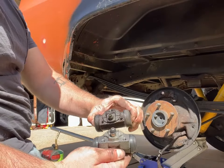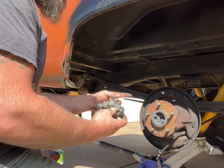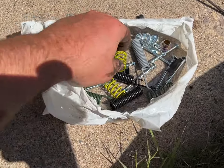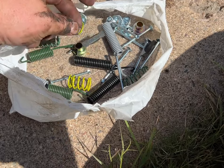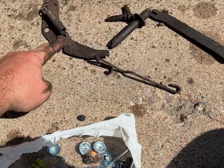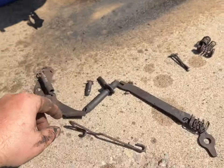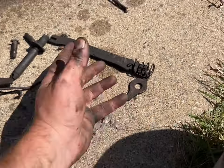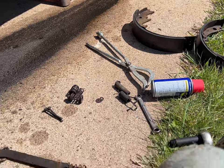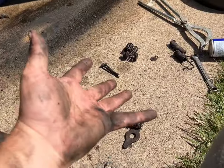Do a quick comparison — make sure they're both the same. Pop this plug out, get your brake fluid holes on there, put her on and should be good. The new kit is gonna come with all new springs, pins, bushings, so you will have to reuse some stuff — basically the emergency brake components, your adjuster, your pins that go into your wheel cylinder, and this washer. The rest of the stuff — put it off to the side in case you decide you want to reuse the old stuff. Just replace the new stuff with the new parts and reassemble.